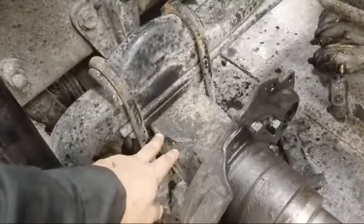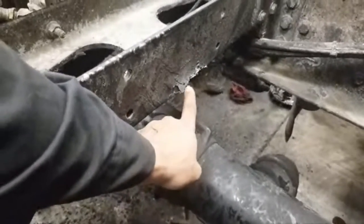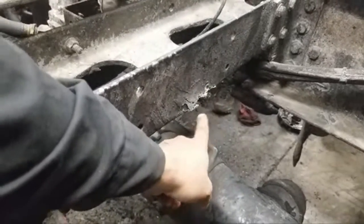But we're also going to replace the U-bolts because earlier the U-bolts gave out, and this is what happened here. You can see that our drive shaft actually struck the cross member earlier this week. Essentially, what happened was U-bolts came off on the back end and just pivoted up the axle, so that's what caused that. And that was a crazy repair bill out in service. So I'm just gonna go ahead and replace the U-bolts on all the other trucks because I don't ever want to spend that crazy amount of money on U-bolts. It was about a $1,900 repair bill, but all those parts probably about $4,000 or $5,000. Let's show you guys the repair bill.